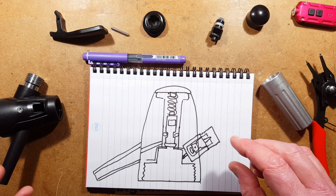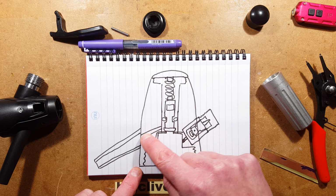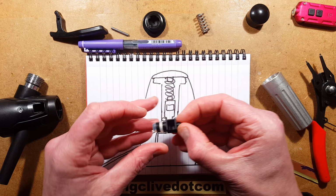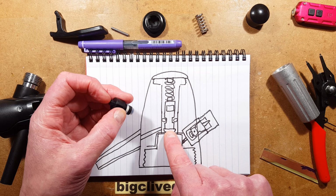The next bit that's worth mentioning is this plunger here. So here is the cap that sits on. That's the gas injector I've just reassembled. The next thing is the device that actually lets the liquid back out when you squeeze the handle, but it's got a double function. There's this powerful spring, and it actually acts as a safety pressure release. So what happens here is this slides up and down inside the little port here. And normally this pad here presses hard against the top where the liquid and the gas would normally come out. And there's an O-ring that slides up and down here.